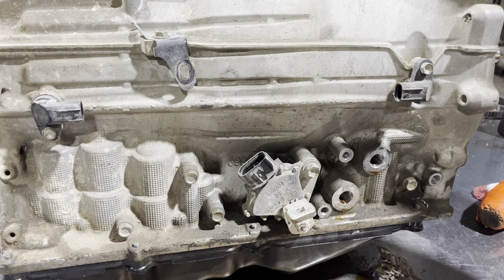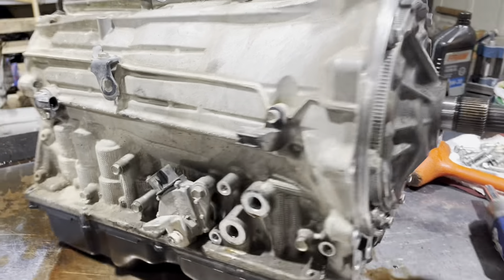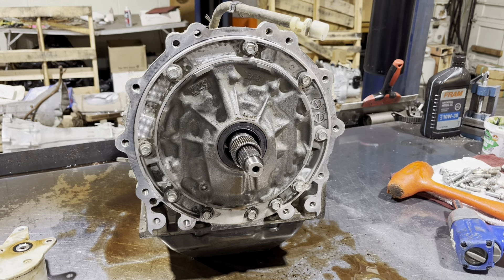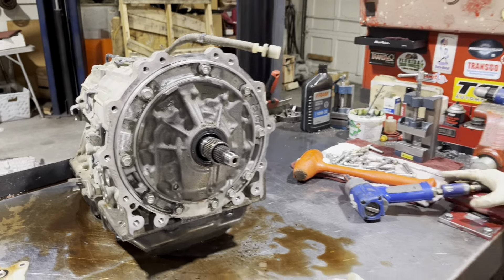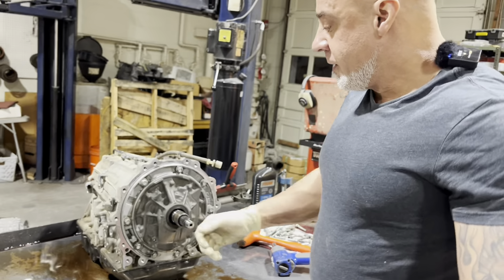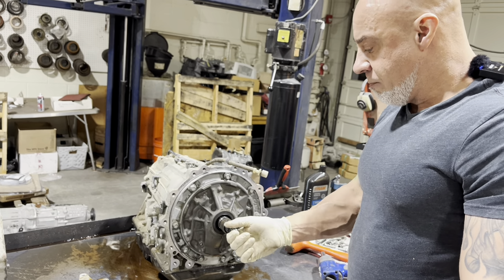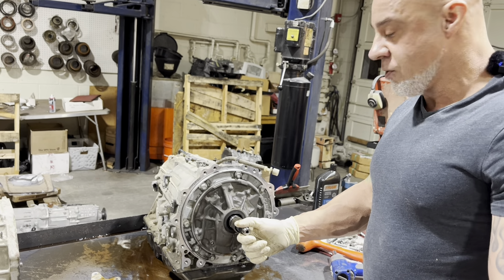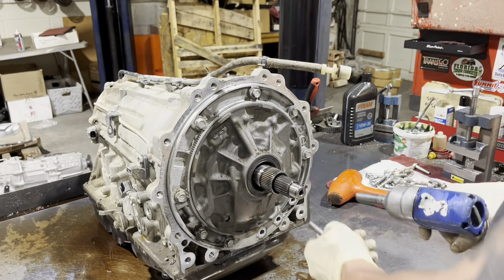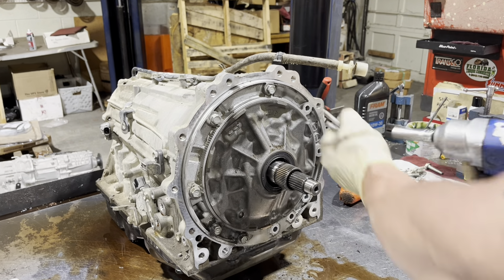This thing looks like I may need to take the hot wrench to it, or maybe remove it from inside the valve body as I've shown in other videos. For now it stays - we're just kind of doing an exploratory here. I'm probably going to do a couple of different videos with this transmission. Now this code P2757 is indicative of converter clutch slip - there are several things that could cause it. In any transmission, if your front stator bushing wears out, your converter apply oil could kind of go back in that way and cause it to burn up. But on these things, the stator bushing - I've never even seen it as a problem. If you're working on something else it's really critical, like front-wheel-drive Fords - they're known for it. It just wears that bushing out and it cooks the torque converter.